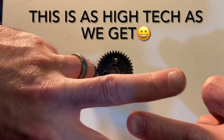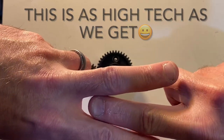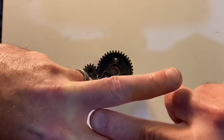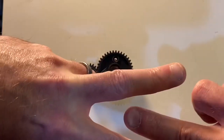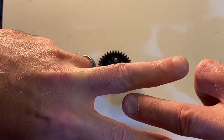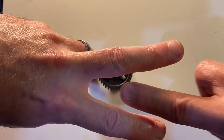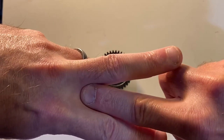This just represents one tooth sliding into another tooth. What we're trying to do is get that gear to sit in there, and as you start the rotation it just wants to push the other gear along. You don't want it to bang into it and slap it and hit it - you want it to just push it in rotation. The other thing you don't want is to jam this gear too far in horizontally and create a wedge both in a horizontal direction and at the tips.